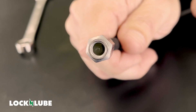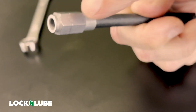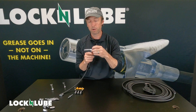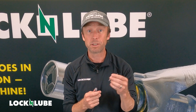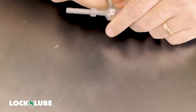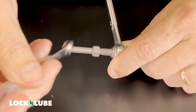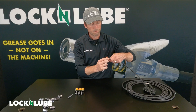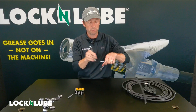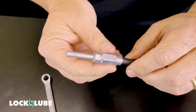You can see that it is now all the way down — it's bottomed out on the hose. This threaded sleeve has gone down around the outside of the hose and the hose barb is going to go down on the inside of the hose. Between the two of them, they're going to create a super secure connection. The great thing is, if for any reason you needed to change things around, reuse this length of hose, use it on a new machine — these are easy to disconnect just as they're easy to connect. So we're going to work this down into the hose, then grab our 10 millimeter wrench and secure that end with our other wrench. It'll get really nice and snug at the end as the two metal pieces connect and your hose barb is fully installed.